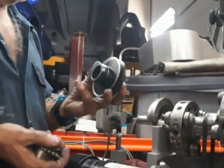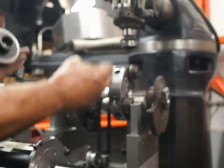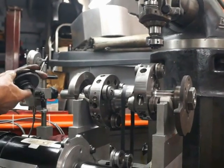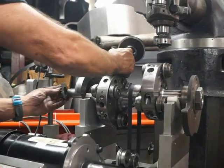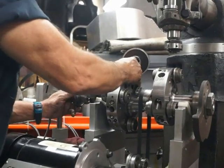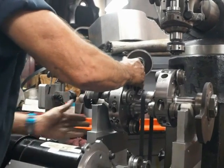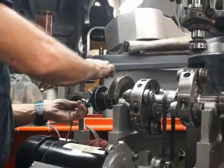With a mechanically driven fuel pump and accessories in the front that use cog belts and stuff like that, then it's really essential to use that whole pulley set. But by basically running this aluminum pulley, which doesn't weigh anything, I'm balancing what is within the engine. All my race engines use this type of pulley setup.